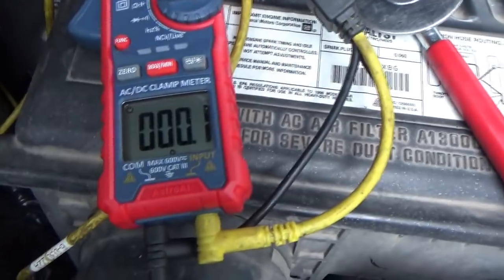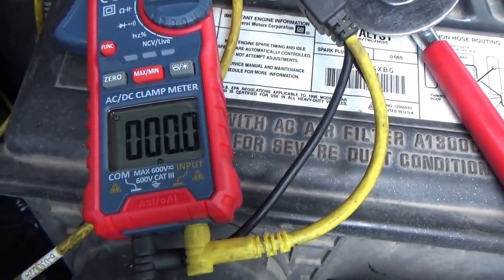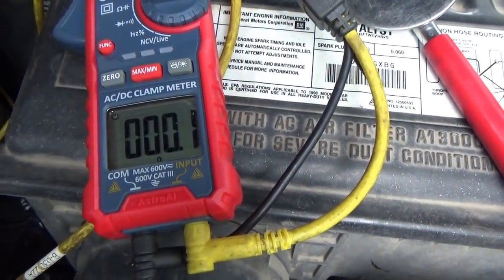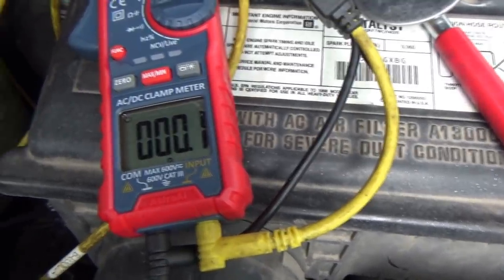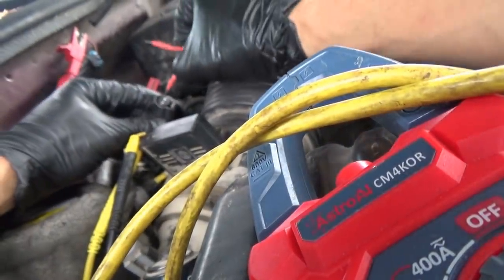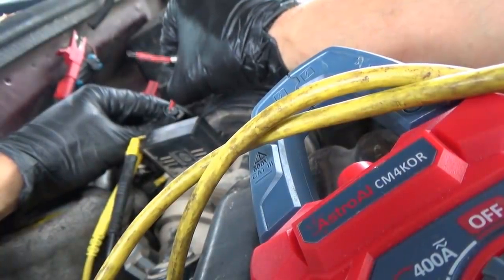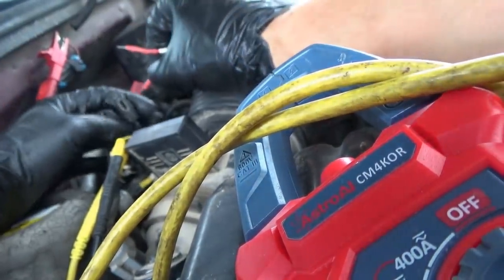I'm going to flex the pins — if the sensor is bad, we should see a dropout. If not, then we'd be firing the parts cannon for no reason. That sensor looks perfect. So let's do a drag check on the actual female side. On the female connector, doing a drag check — these pins do feel quite loose, both of them. That's why torquing it one way or another actually made a difference.